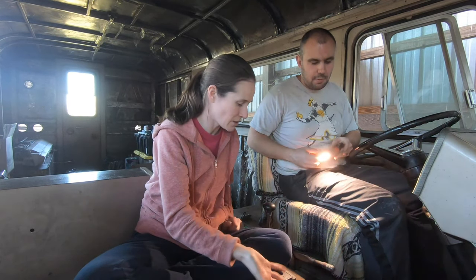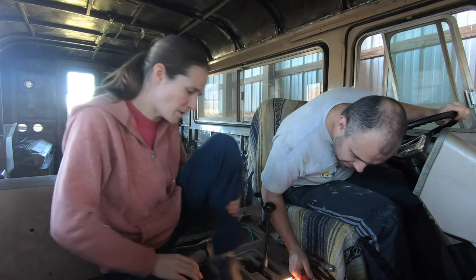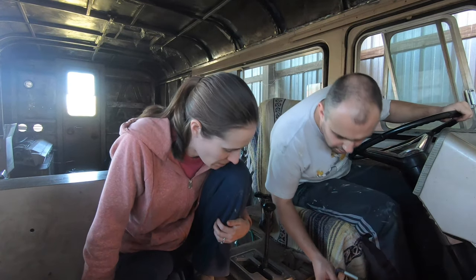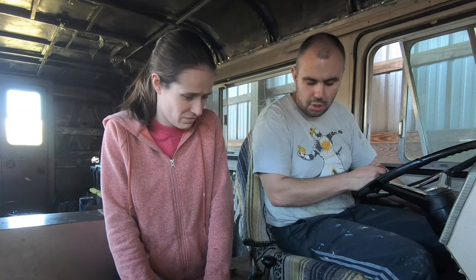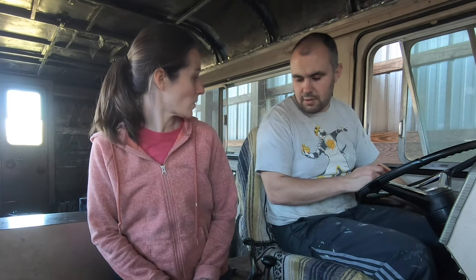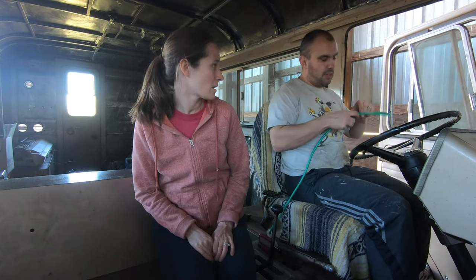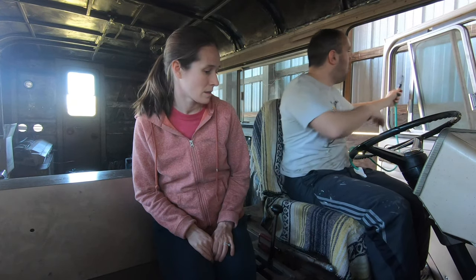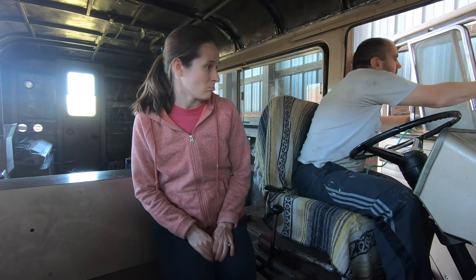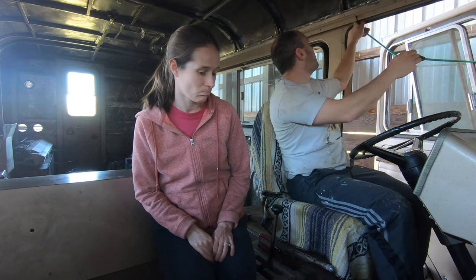Well, we know it's the clutch wire. That's probably what went rattling. I think you heard it when we fired it up. The hydraulic line could have failed, or something more catastrophic. That rattling didn't sound good. I think the master cylinder or the slave cylinder failed, because the master cylinder was leaking anyway. We talked about changing them both, but hopefully it's that, because if it's the transmission, it's going to be a massive job.